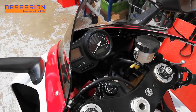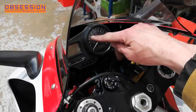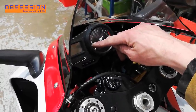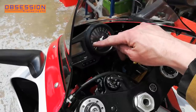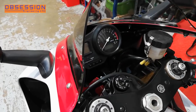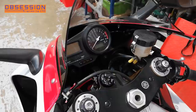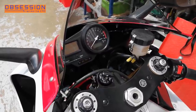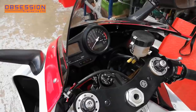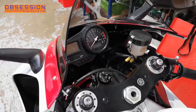On the test ride, what was happening was when you were dropping down to low RPM, you were sort of revving the bike a little bit, and as you drop down it would sort of hover at around two, two and a half thousand RPM. And after maybe five or ten seconds it eventually would drop down to normal idle, which is obviously a little bit odd and it's not supposed to do that. Now it's distinctly possible that it's sucking air in around the carburettor somewhere, like an inlet rubber split or something like that, or the carbs are set wrong.